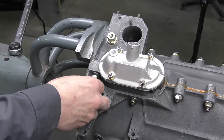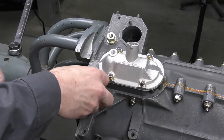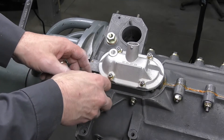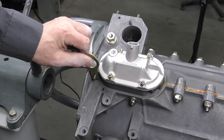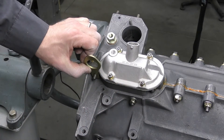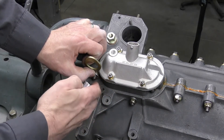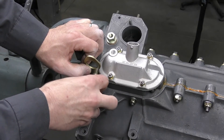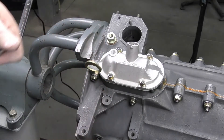Next, we're going to go ahead — we left this nut loose when I sealed the crankcase. This is because the lifting hook is attached on this stud, and the lifting hook cannot go in before the breather plate is attached. The lifting hook just sits straight up against it, and you can see by the radius here that if we had attached it first and then tried to put the breather plate on, it will not fit. So now I'm just going to go ahead and reinstall that nut and washer and tighten this to 25 newton meters.